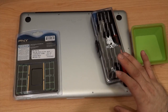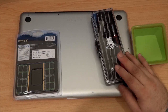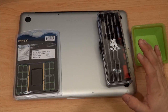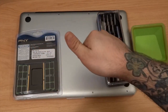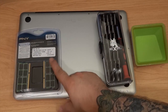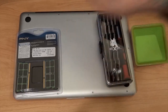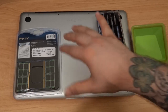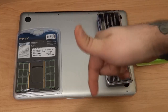Whether you're changing out the memory in your MacBook Pro or any of your favorite Apple products, the answer is simply no — it won't void your warranty unless you mess it up or the memory you buy messes up your computer. Apple actually encourages you to change out the hard drive or the memory, and they provide documentation on how to do this within the MacBook user manual, available online or in the link below the video.